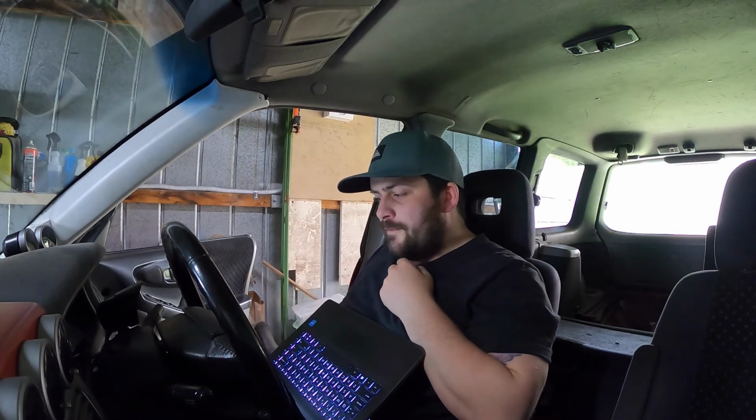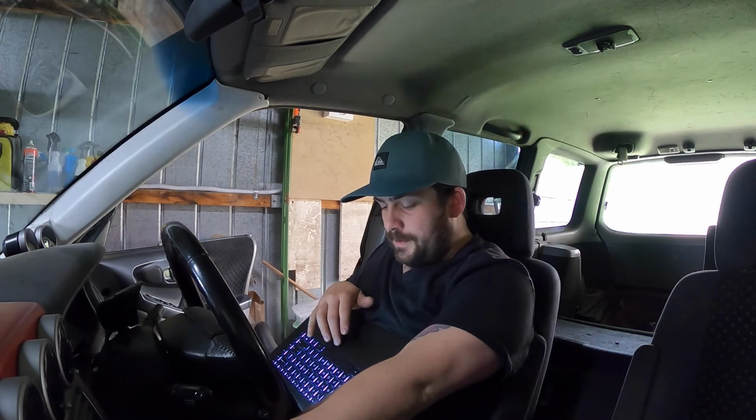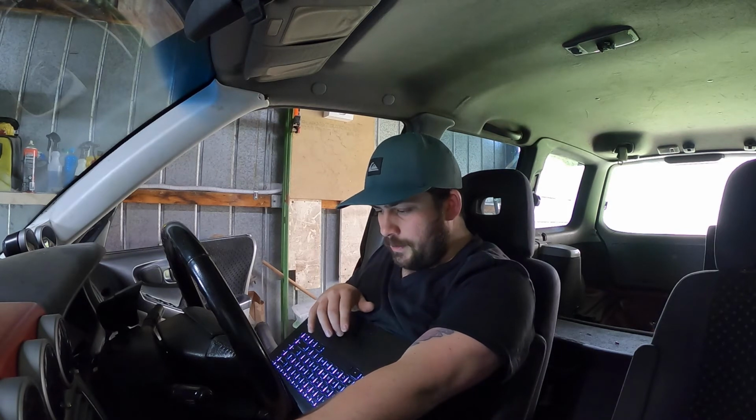Alright guys, so I just undid the transition that I did between the 5% and the unscaled, and then I just did from that cell down, added 5%, and we hit 300 at the very top at 4.69 volts. So we are maxed out. It was very close before. So I'll go do another drive, or flash it in, sorry, and then I'll go do another drive, see how we are.